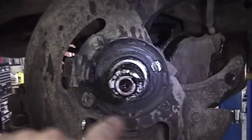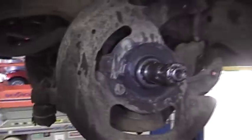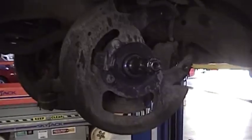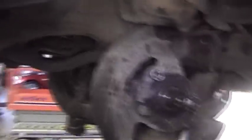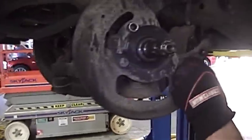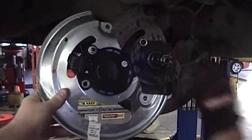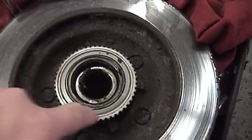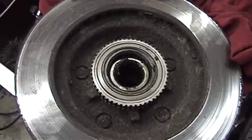There's the old backing plate, and this right in the middle is the ABS sensor. This works very simply: when the brakes are applied, the ABS computer watches for any wheel that is slowing down at a much greater rate, implying that it might be about to lock up. And if a wheel stops rotating while the others still are, then the ABS computer tries to help you maintain control by electronically pumping the brakes via a pump and motor system. There's the old sensor and old surround plate it's mounted to, and here by comparison is the new one — wow, doesn't that look a lot different? And then here on the back of the brake rotor itself is the serrated wheel that the computer uses to sense how fast or if the wheel is turning. Very similar to the setup on the Caprice wagon.